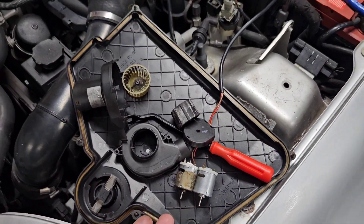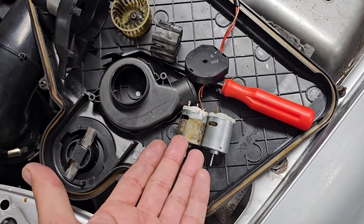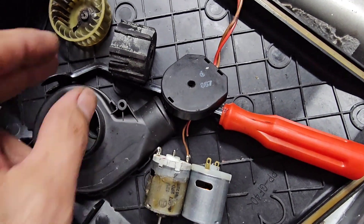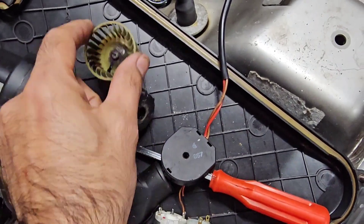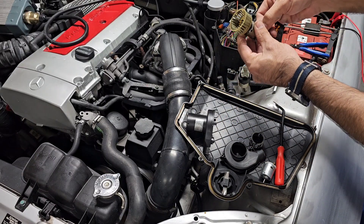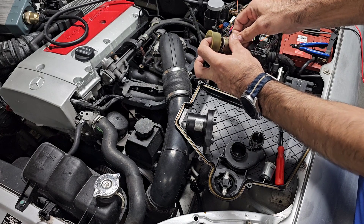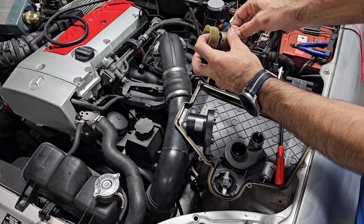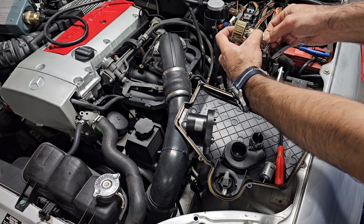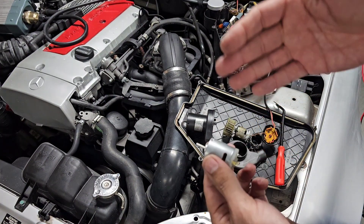It's very straightforward to put back together and easy to dismantle. Make sure to connect it in the same format — the direction of rotation is very important. You don't want to end up pulling air instead of pushing it. When you switch on the ignition this fan starts working. As you can see the brushes are worn, but when I push on the shaft it starts rotating clockwise. So you need to connect this motor to the two wires and have a clockwise rotation.